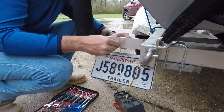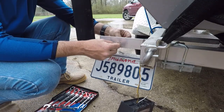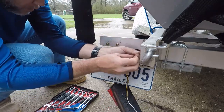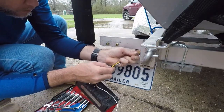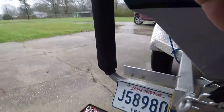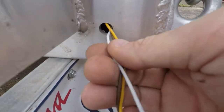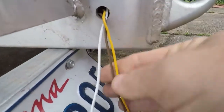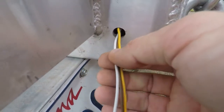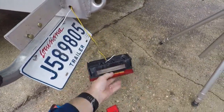On the back side they've got the ground — a couple of grounds hooked up. I'll make sure those are still kept good. This hole is pretty sharp where that goes through — there's a burr on it in there and there's really no protection for these wires. Before I finish this up, I'm going to take some hose if I can find it and wrap it around that so it's protected as it goes through, because that really should have a grommet on it.